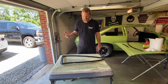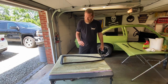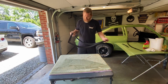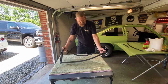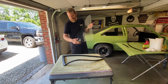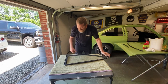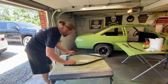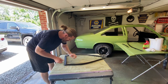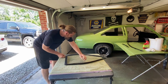I'm going to attempt to put this thing together. I did one already and it went okay. I had these rubber gaskets out in the sun — they are nice and pliable right now, stretchy. I go ahead and start with the flat side of the window, put it on top of the gasket, spread the corners out, and insert one corner, then the next, getting it in there nice and tight.